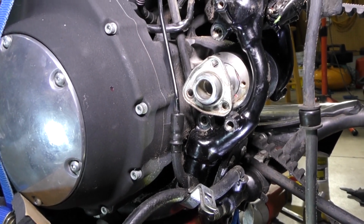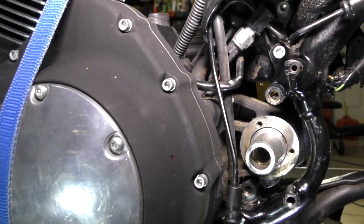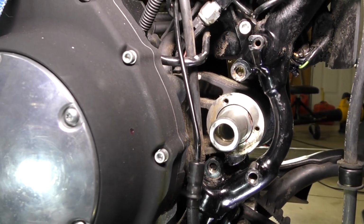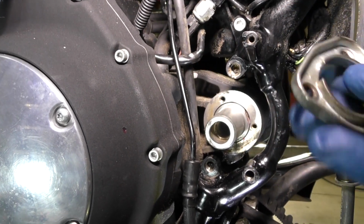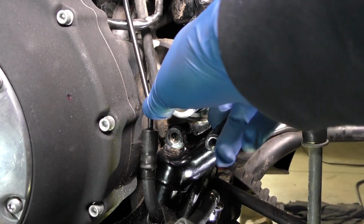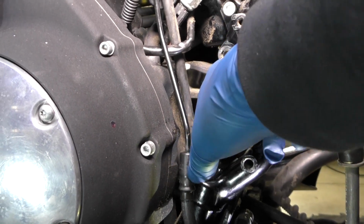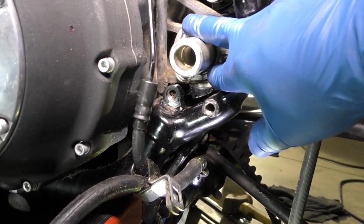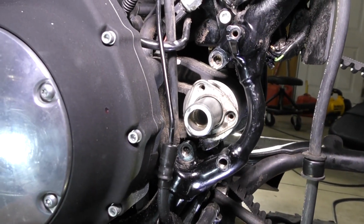Now when you go to put the cap back over the shaft cover, you have to make sure there's little slots in the shaft where these little indentations right here keep it from spinning. So you have to make sure it's all aligned right. When you put it back in, you can feel if it's in the right spot. Which it's not quite in the right spot right now. I gotta move. Oh no. Nope, it looks like I might have to move it back just a little bit, but just an important point when you're putting it back together there.